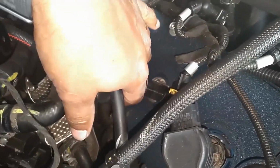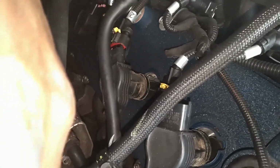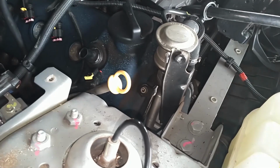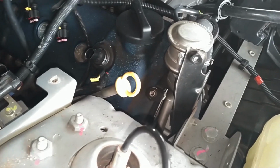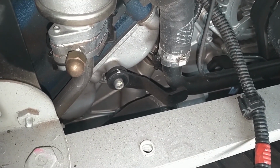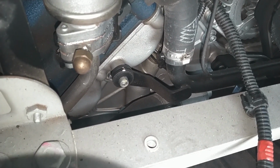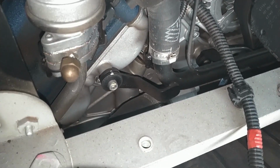These coils just come up out of the valve cover. They're in there pretty tight, and as you can see, they're keyed with the coil. So you just wiggle them and pull on them and they pop out. Next, I'm using a T30 to get these out, but they're probably like a hex 4 or 5. I got 3 there, 1, 2, 3. These 2 up here are holding this valve, and then it's got a bracket down there. Like I said, not 100% sure what that's for, but it's got a line coming in the bottom and a line coming in the top, but I'm going to need to get that and wiggle it out of the way to get the valve cover off.